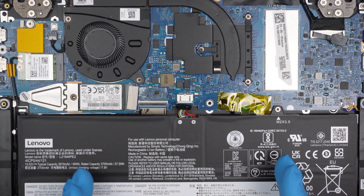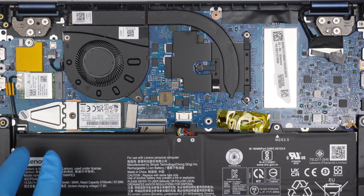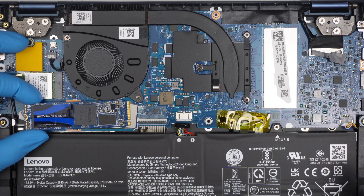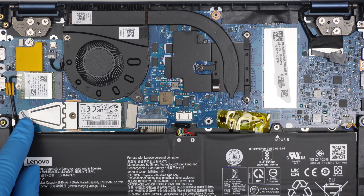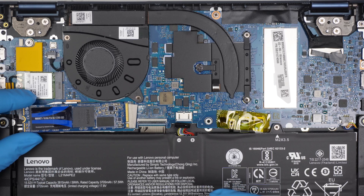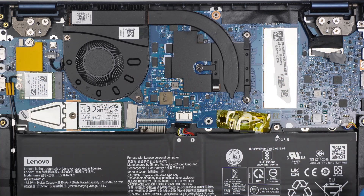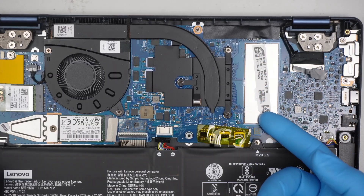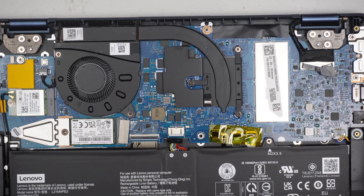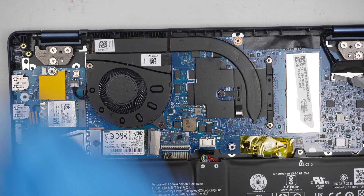You can do a battery replacement if needed. This is the M.2 SSD drive — you can upgrade to a full-size M.2 SSD. All you have to do is remove that screw here. This tape is the void warranty tape; you can break that and replace it with a larger M.2 SSD if needed. There's no RAM upgrade available because the RAM is soldered to the motherboard, unfortunately. That's the repair — thanks for watching, until next time, bye!